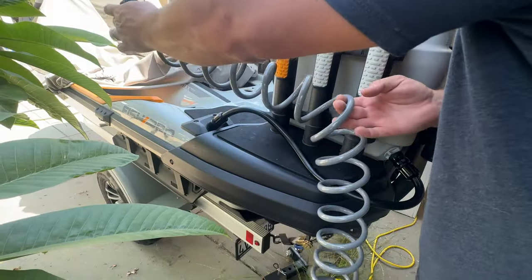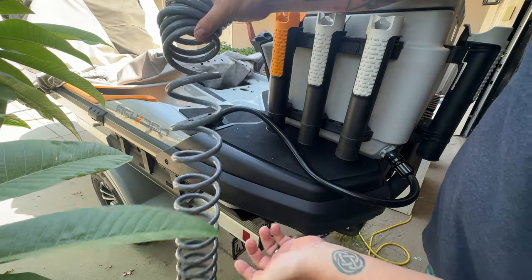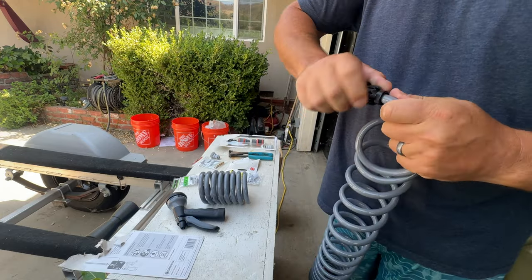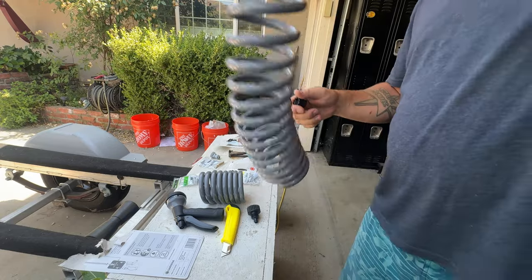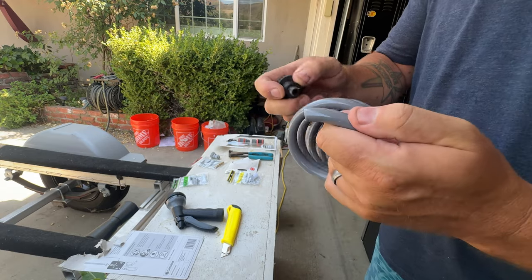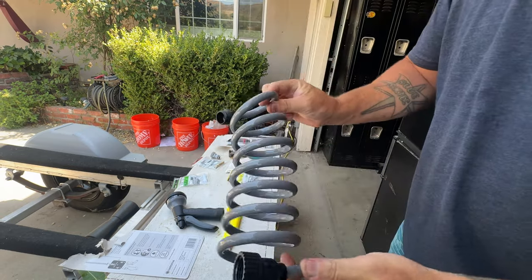The only distance you need for a wash down hose is from this connector to where you want to wash down when you dispatch fish — we're only going to do about this long. We don't need much; it's not a big boat, it's just a jet ski. Now all we need to do is take this end, just like the other one, take the screw-in connector, get rid of the extra hose — save it for a later date. Now just connect the screw-in fitting and screw that on to the base. Now you have a wash down hose — screw in the gun.